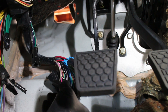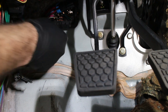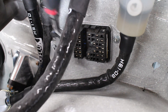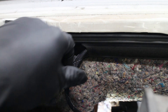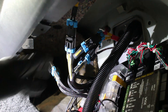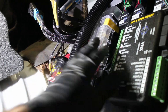After that plug is installed, the C100 plug is then bolted back onto the firewall. I ran some 10 gauge wires to my power board that's underneath my passenger kick panel. So when my switchboard is turned on, both of the wires get 12V power. In a normal swap, these two wires would simply be routed to the battery with some fuses in line.